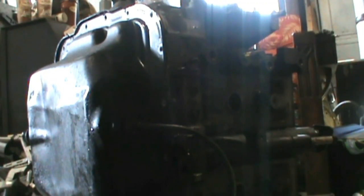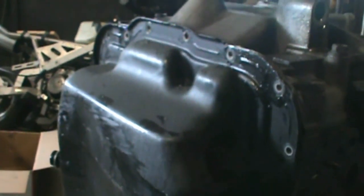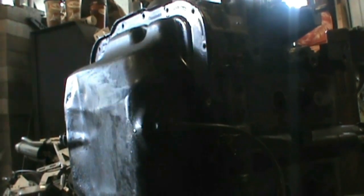So I got all the bolts out for the oil pan and the engine mounts off. These things you gotta be kind of careful because they're only like a thin stamp steel. So just find a spot around here — you can usually find one like this. See how there's like this little lip there on the actual cast into the middle? Just kind of lightly pry it apart and then you just have to pretty much work your way all the way around the oil pan. You don't want to bend it out too hard and end up warping the pan.